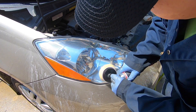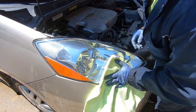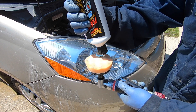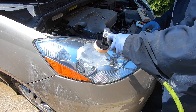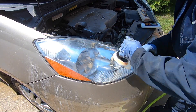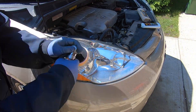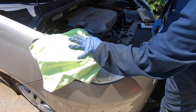It's also really important to ensure that you move the tool back and forth on the lens to prevent burning of the plastic. Use a microfiber cloth and remove the excess polishing compound. For our final headlamp polish, I've switched out my waffle pad with a new one and I'm going to apply a generous amount of Meguiar's Plastex plastic polish, spread it across the headlamp lens, and use the speed of the tool in conjunction with the polishing compound to achieve the final finish. Ensure that the tool remains moving on the lens to prevent any plastic burning. Using a microfiber cloth, remove the excess polishing compound from the headlamp lens and the adjoining painted surfaces.